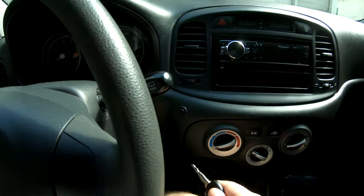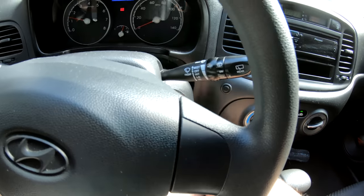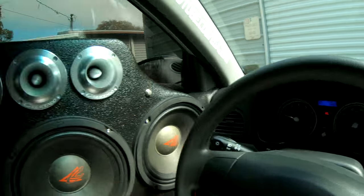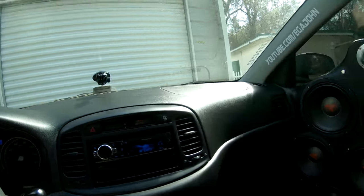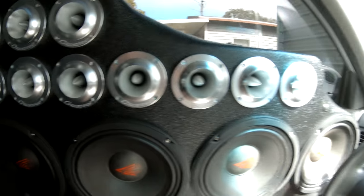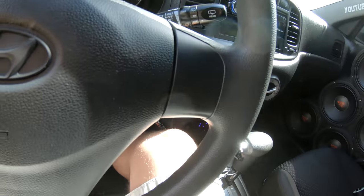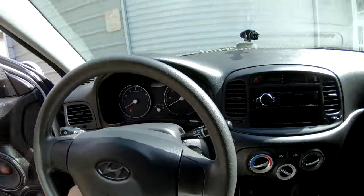It's a pain in the ass. Turn on the radio — watch, it might not do it. Turn on the mids amps. Yeah, you hear that? It's the left channel. Now they're all squealing. The right side is perfectly silent. So the left side RCAs are bad again. I have one more set, going to have to swap them out real quick and fix the issue. It's just annoying — I went over a railroad track and it must have loosened up, and then it just started squealing in my ear.